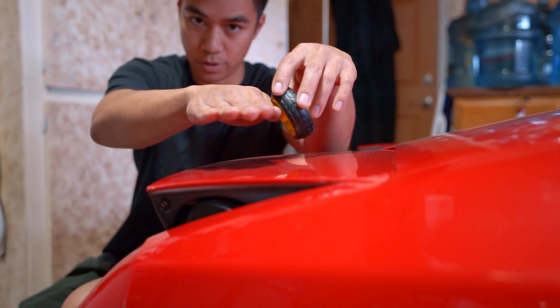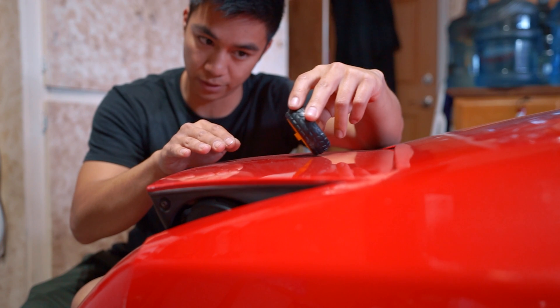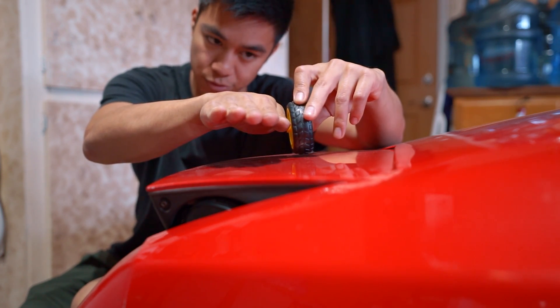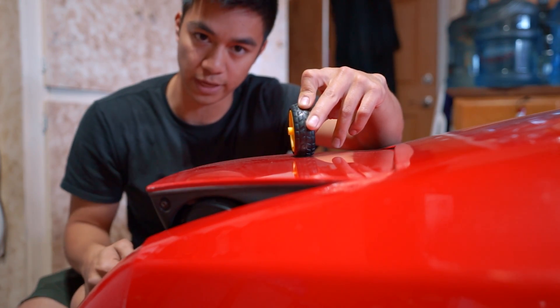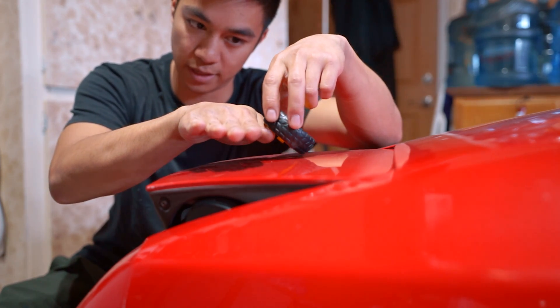Lowering your car on aftermarket suspension messes this whole geometry up. Most of the time, lowering your car puts your wheel at a very aggressive angle, so you have to bring it back to almost square to keep that contact patch flat. That's why adding more camber to a car that's already low doesn't work, because you're just making that angle even worse.